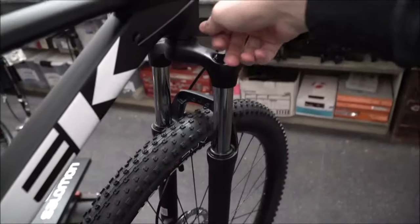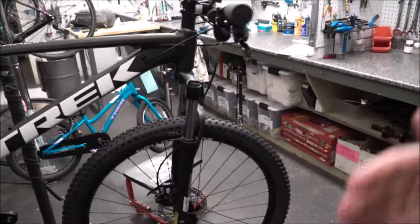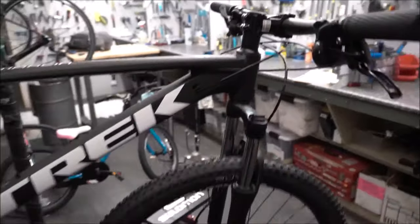So what this means is when you're actually climbing a hill, you're able to turn that suspension to a locked out position, therefore getting the power from your pedals straight to the wheels, no efficiency loss. In some Marlin levels, you are able to manually turn these on and off, but to be honest, most of the time, by the time you're halfway up the hill, you forgot to do it. It's gonna be more cumbersome to try and reach down, and you probably never use that feature.